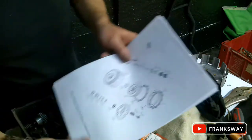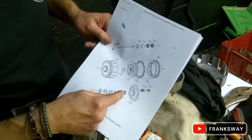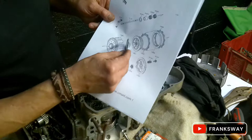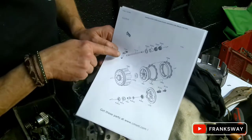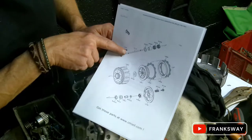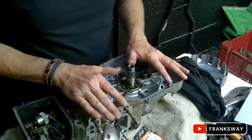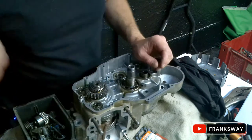Let's quickly have a look. Clutch basket - it will show you washers, nut, spacer, bearing, and springs. There's a washer that goes in the middle between the basket. Then you line up your clutch plates, and the clutch pin - this one has no ball bearing, just what you bring. Let me quickly sort that out, get all the stuff out of the box. I've washed it and then we'll start the assembly on this one. It'll be fairly quick.